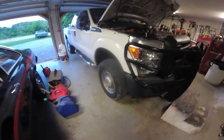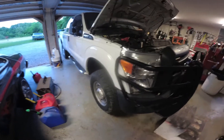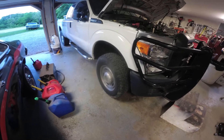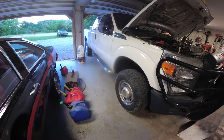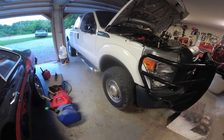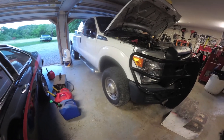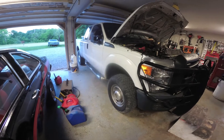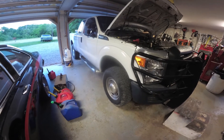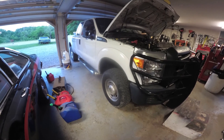I think we've done everything we need to do on this truck. I just have to get in the cab and reset the oil life. I've inspected all the tires and I'm going to go around with my little digital meter and make sure I've got 65 pounds in them — I'm pretty sure I was running more than that. I'll get all these set and we'll wrap this up. Thanks for hanging out with me doing some routine maintenance on the F-250 Super Duty — this is our tow rig and that's how we make our living, so we've got to keep it at least halfway fresh. Please subscribe and stay clean everybody.